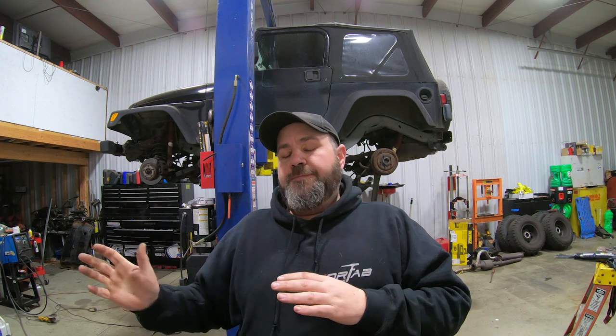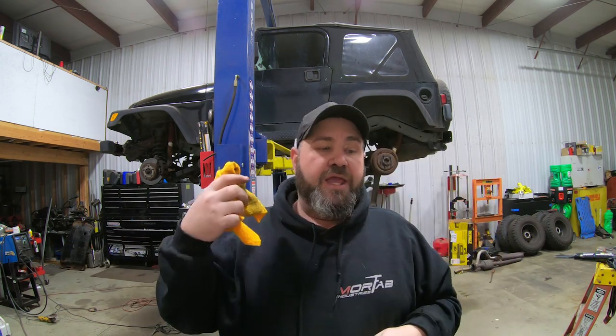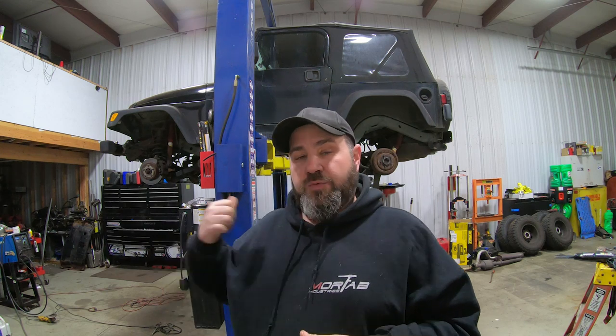We did the passenger side first - a full weld out, got all of that stuff welded in and stiff and ready to go. Then we moved on to the driver's side, cut all of that out, got the new piece in, fully welded. Then we started our treatment process: initially cleaning the metal with a wire brush or flap disc to get all the weld scale and weld spatter off, then cleaning with a microfiber, then hitting it again with a microfiber with acetone or alcohol to prepare the fresh metal to take paint. Then we hit it with a Rust-Oleum self-etching primer - and here's a secret - you can actually weld through it. I've welded through it many times without an issue. We let that dry, throw a coat of flat black paint on it because we don't want gloss. If you're doing this yourself and the rest of your frame is shot, don't go with gloss paint because the repair will be so obvious - fresh metal, fresh paint, super glossy just looks ridiculous. Flat black is my choice.